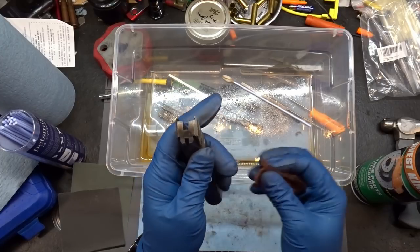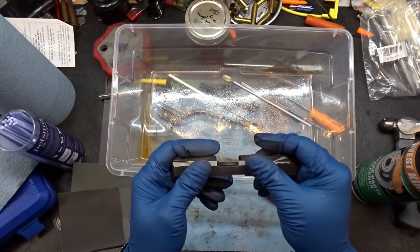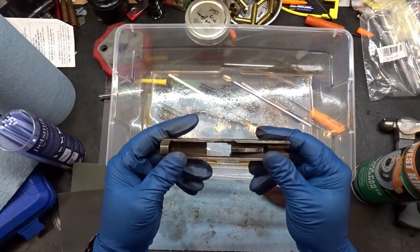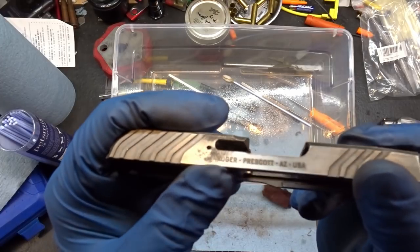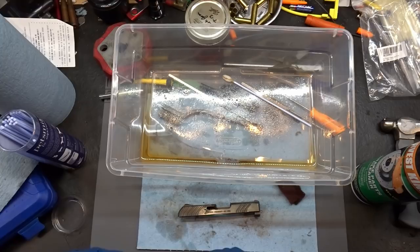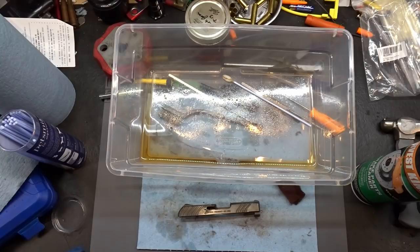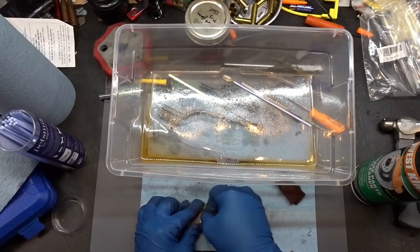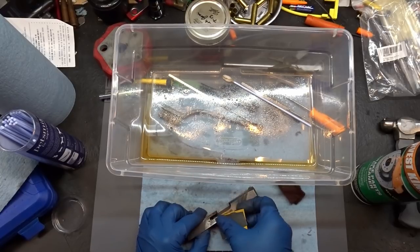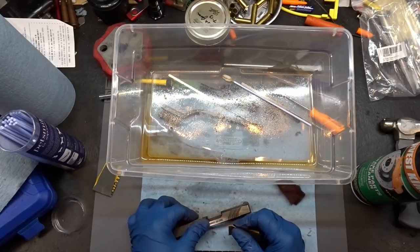The texture is going to be slightly rough - not polished - because we need that new coating to be able to stick. We've got the Scotch-Brite pretty much used up but still have some surface rust here, so we're going to grab some sandpaper. I'll grab thousand-grit first - it's a pretty kind paper, forgiving, doesn't remove a lot of material, which is what I want. I just need to get rid of that pitting. We've got to get rid of the pitting, then come back in and Scotch-Brite it again for proper surface prep.